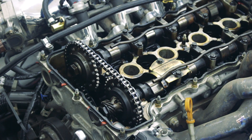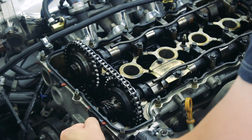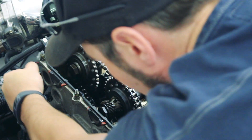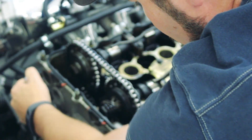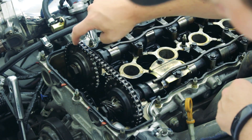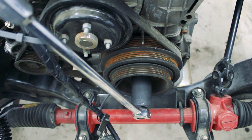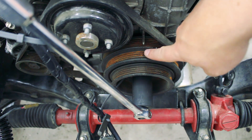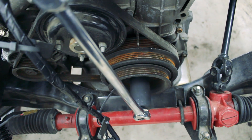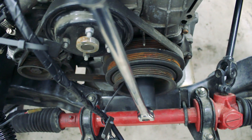Turning the crankshaft will in turn rotate the cams via the timing chain. There are several rules of thumb to find the right position. Some say there are dark links on the timing chain that should align with the holes in the camshaft, but I have seen that these links do not exist in some timing chains. Another rule of thumb is that the cams should be pointed away from each other in direct opposition, with the lobes pointing outward. This is a good rule of thumb but not precise enough. Ultimately, the best way to do it is with the timing marks on the pulley. My crank pulley has six marks. The mark I used is the first mark in from the left, so count one mark in from the farthest-out mark. You can see these marks at the end of the pin protruding from the block — you can barely see them in the video.